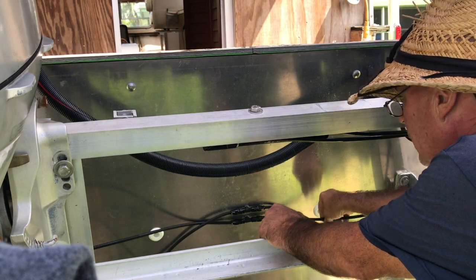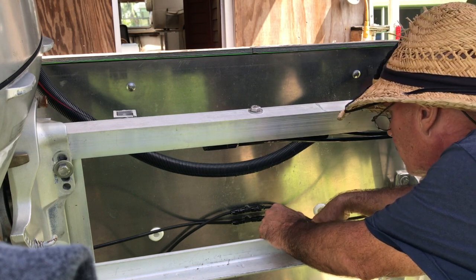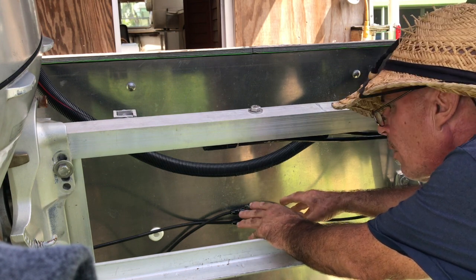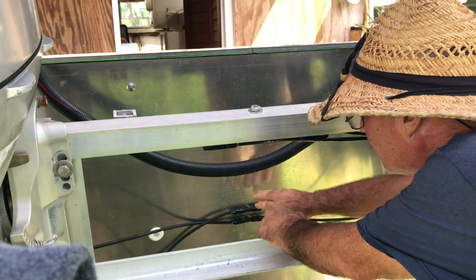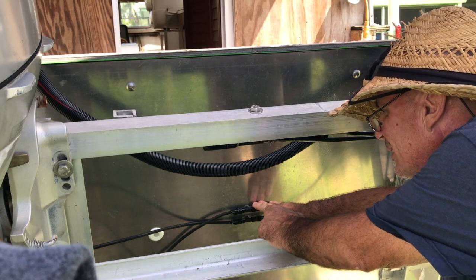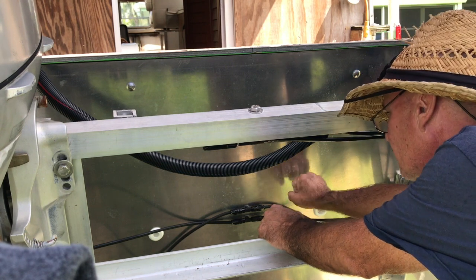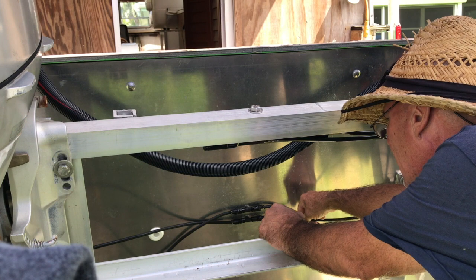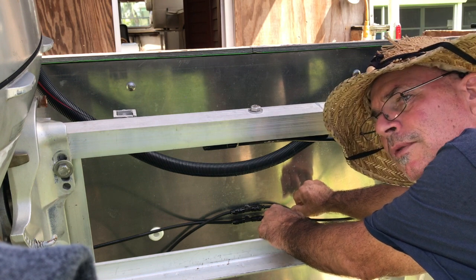The lines and fittings I used for this are all from a company called Vibrant Performance — it's a high-performance car line, mostly for fuel. I chose all these components trying to avoid any problems at all with corrosion between dissimilar metals, so all these fittings are aluminum. They're not really rated with any numbers, not recommended for high-pressure hydraulic, but this really isn't high-pressure and I think they'll be just fine — so far so good. The line itself is stainless braid, but it does have a coating on it, which hopefully keeps down any contact between the aluminum and the stainless.